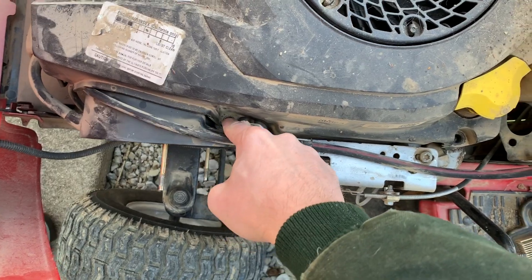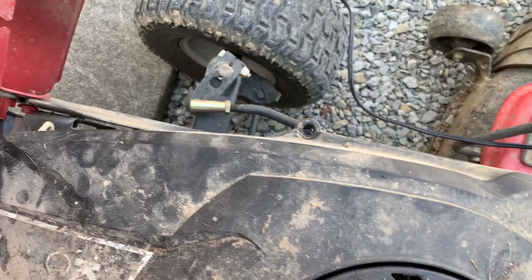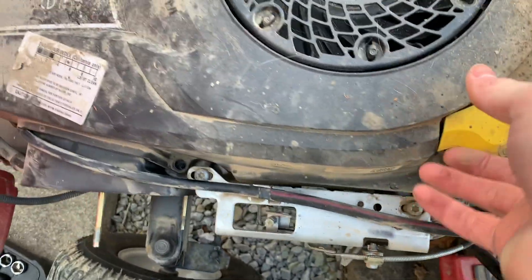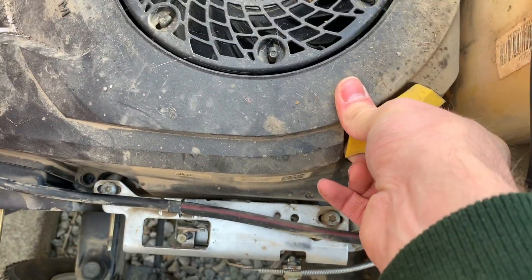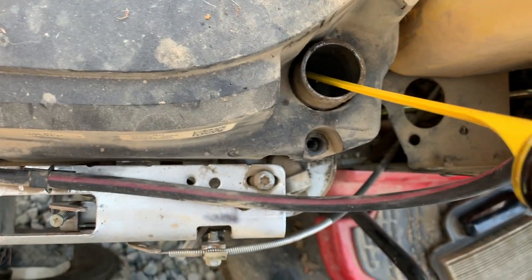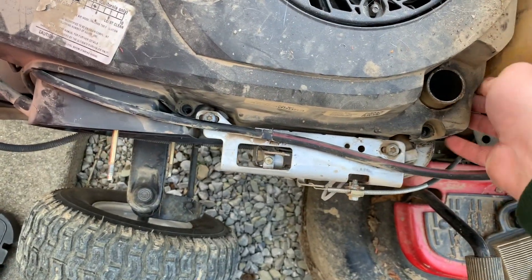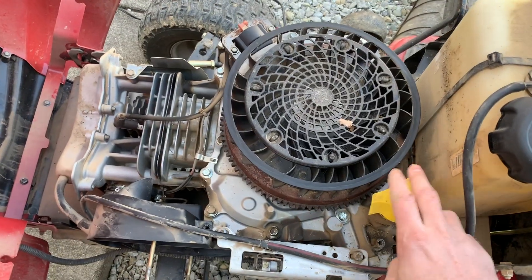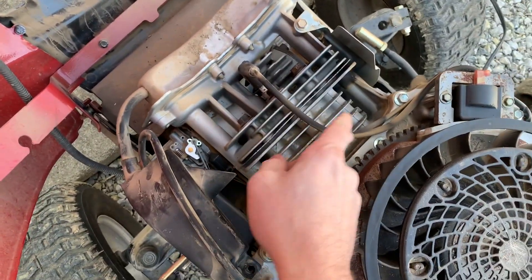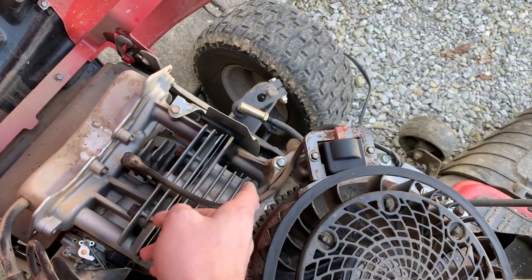There are four 8 millimeter bolts - one here, one here, one right there, and one there. Don't take this tube off. Make sure it's all clean around here - you don't want junk falling into your motor. Look at how dirty that is; I really should wipe that off. We're in a really dusty environment. Lift that cover straight off, then put it back on so nothing falls into your motor. Here's your spark plug - super easy to replace that too. Tune-up on this thing's a breeze.